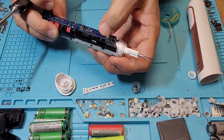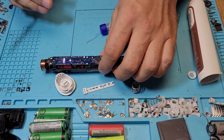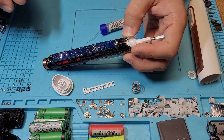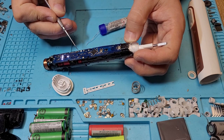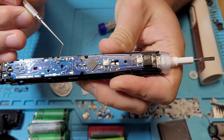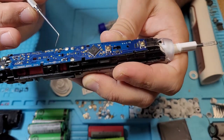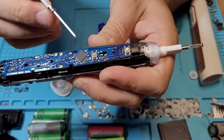Let's try it out. Wonderful — that's it. So if you have a toothbrush that lights up but doesn't function, doesn't vibrate, you have one separate fuse that channels the amperage through the MOSFET and through the motor contacts. And you have one more smaller fuse that is responsible, I assume, for the whole electronics of this toothbrush.